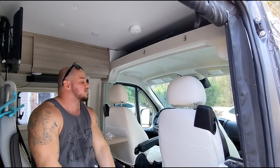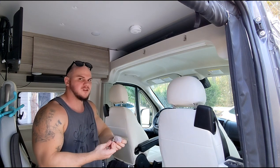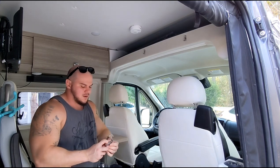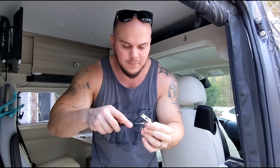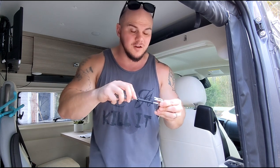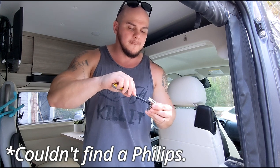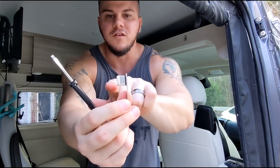I've got two of them installed and I'm going to install the third, but I wanted to show you guys exactly what I did to install this on the Winnebago Travato 59GL — we have a 2022, but it works on previous years too. You see this attachment piece here — you don't need all of it. You just unscrew it using a Phillips head, throw the extra pieces aside, you only need these two pieces. You use the screw from the ProMaster and this piece bends down, rotates around your rod, and snaps right in.